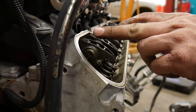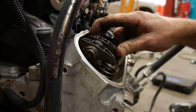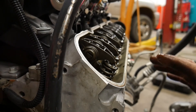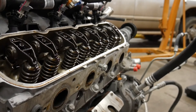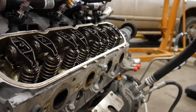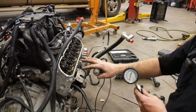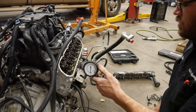I was just cranking it over and now I have oil coming out the top of the pushrod, and my slack is gone - most of it anyway. It probably pumped up that lifter a little bit once I built some oil pressure, and now it's lubricating the upper valve train. So I'm going to put the compression gauge back in and check this cylinder to see if it has gone up. Now we know the pushrods are moving about the same as the rest of them - the camshaft's good. It did take a little bit for this lifter to pump up, and it may not be fully pumped up since sometimes you have to have the engine running at a higher RPM warmed up. But we'll see if we gained any compression.